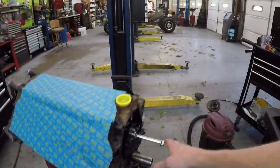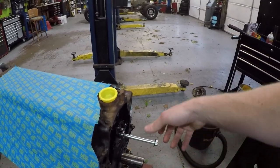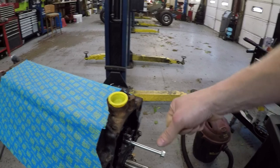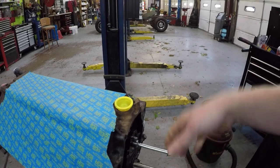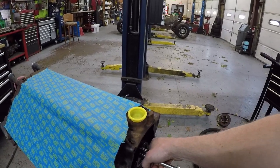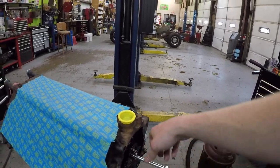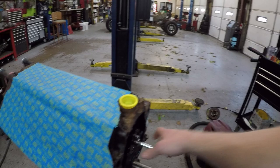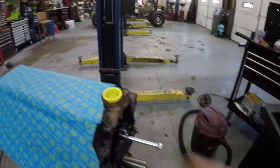As far as putting the camshaft in, I take a long bolt — this is a 3/8 bolt right here — and I put that bolt in there to help have leverage so I can slide it through the cam bearings without tearing them up. Especially once you get real close to the engine, it's really hard to hold that cam, especially with all the assembly lube on it. So I like to put that bolt in there — get a decent three or four inch long bolt — and that way it helps you have leverage and you can slide it all the way back with no issues.